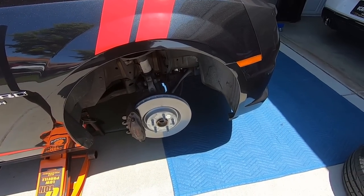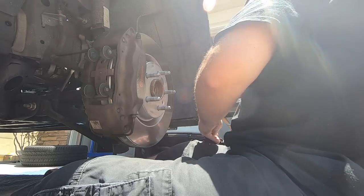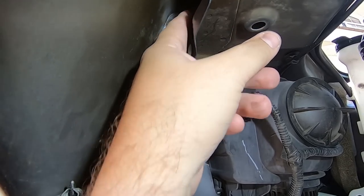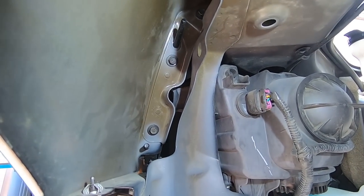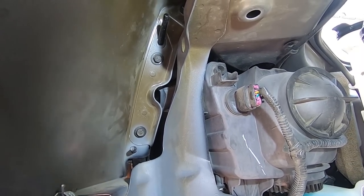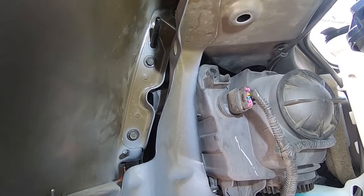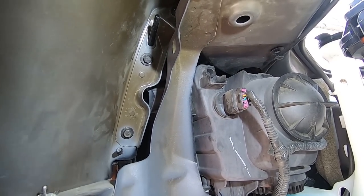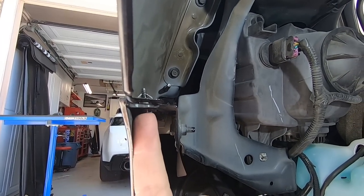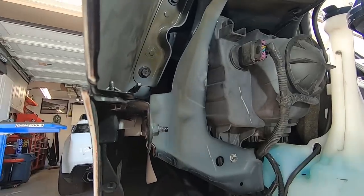Now we will rinse and repeat on this side. I'll apologize for the darkness, but you can see there are three bolts — one here, one there, one there — that hold basically your front fascia to the front side of the vehicle. We need to remove those; those are 10 millimeter bolts and they'll come right out. There's also a 7 millimeter bolt right here that needs to be removed, holding the side clip of the vehicle to the metal part of the fender.